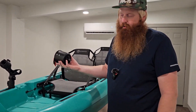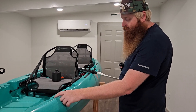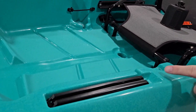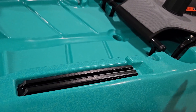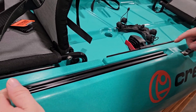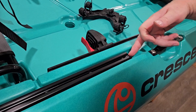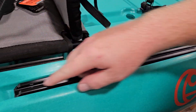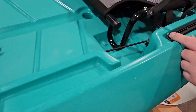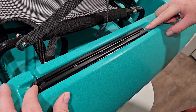One more quick thing: on the front mounted rail system, push it all the way to the forward notch because all your rail mounted attachments will come in through this dip. Here on the center, you can see we have a dip each way — just center your rail here and you can put attachments in this way or in this way. On the rear set, same thing — centered in the middle so you can get attachments in through the back side or the front side.